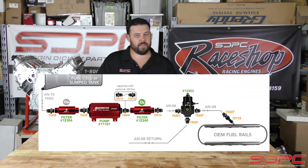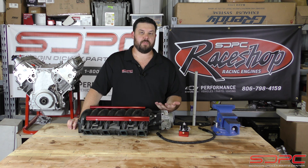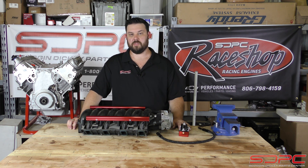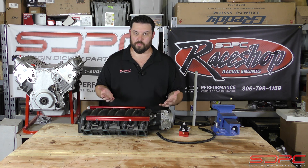That's what you would call a bit of a returnless deadhead style system. And actually for a naturally aspirated setup, just like those fuel pressure regulator and filter combos are meant to do, that's perfectly fine. It can actually handle quite a bit of power. Like we've said, 500, 600 horsepower — people use them on a lot of stuff, trouble free.